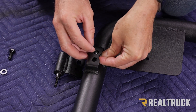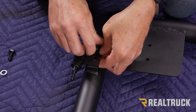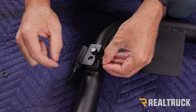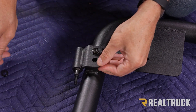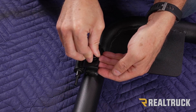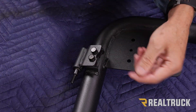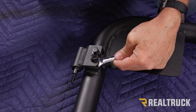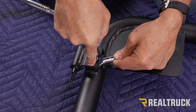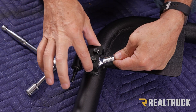There's just not a lot of room to move around underneath here. Get everything lined up at the top, and once you get the thread started, bring it all the way down to the nylock, then do the next one the exact same way. Once you've got this started, take a 13mm wrench to hold the nut and a 13mm ratchet to snug those down. We don't want them fully tightened — just enough so we can still slightly move things around, but where it won't fall on its own.